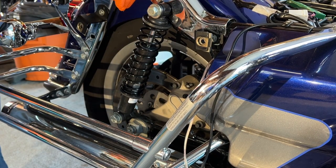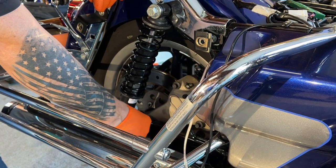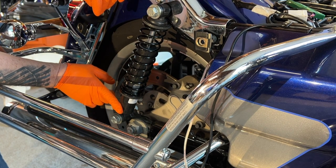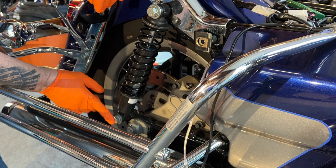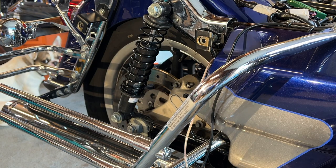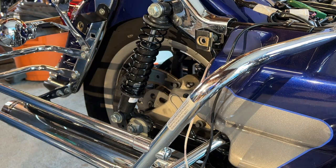So the first thing I'm going to do to take this wheel off is I'm actually going to take this little clip off right here with the screwdriver. I'm going to disconnect the shocks. In order to disconnect the shocks, I'm going to jack the rear wheel up because there's a lot of pressure on it right now from the shocks. Sorry guys, I'm kind of not feeling too well right now — I know I'm all over the place. I just can't sit on that couch or sit in that house anymore, so I'm out here.